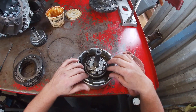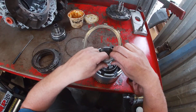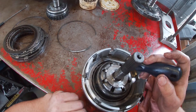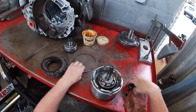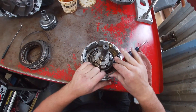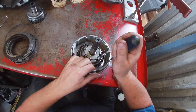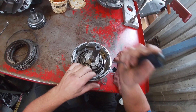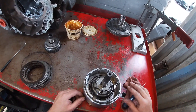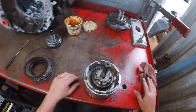We have that in our groove. We're going to do our last clutch disc, making sure it splines to the hub, and then the separator plate — paying attention to how it goes in because we have it stacked in reverse order from how it came out. You can actually see where the snap ring groove is. If you had it upside down, you'd have a fight getting the snap ring in. They will go in — I've made that mistake before — but you want to make sure you're getting the orientation correctly. A good trick: if you have to pause this overhaul, take a zip tie and zip tie the assemblies together so co-workers don't get stuff out of order.